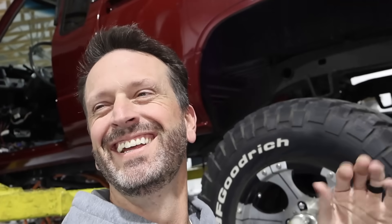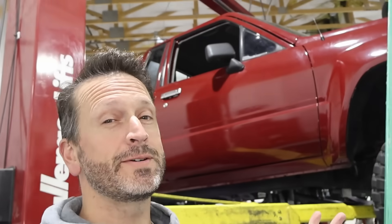That means both a heater core as well as an AC compressor. We're going to replace the heater core, and this truck actually never had AC, so we're going to do the AC system kind of all from scratch. We'll be doing this for a high voltage system, but it's kind of the exact same thing if you're doing it for a 12 volt system. One of the only differences is that for a 12 volt system you would need to do something like 100 amps, where a 400 volt system we can get away with like 20 to 30 amps. We'll do a little recap of how the AC system works, then show you all the steps it takes to get this to work.